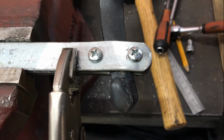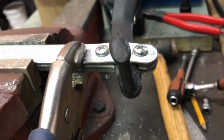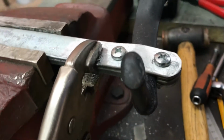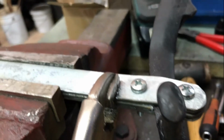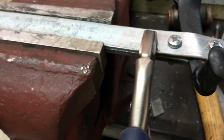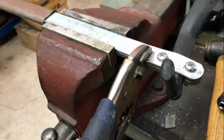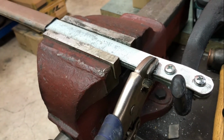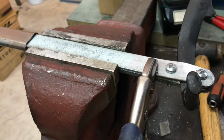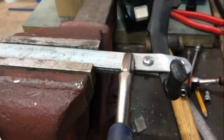So I'll put 2 screws in there to clamp at this stage. They're temporary screws. You can see how the upper piece is bowed up over the lever as part of the clamping. I was using those vice grips to hold things together while I was putting that second screw in, which was mainly holding the centre leaf up tight against the lever, and you can see here it's up tight there, and likewise on the other side.